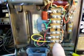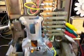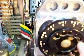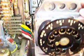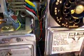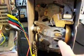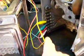And we did some rewiring here at the network and took care of some things and got them in order the way we wanted to have the network. And we made some other connections here and repaired connections and cleaned everything. And we also went through this dial and cleaned it and oiled it the way it's supposed to be. So we got that squared away. And we made sure that our money would drop down into the vault properly. We had to go through the coin changer and make sure everything would work properly. And basically these are some connections here that you see, and that's to make the telephone work when the housing is off of the body.